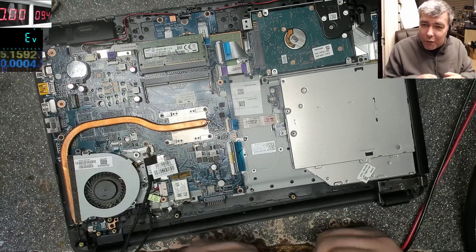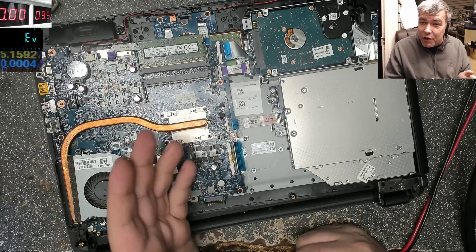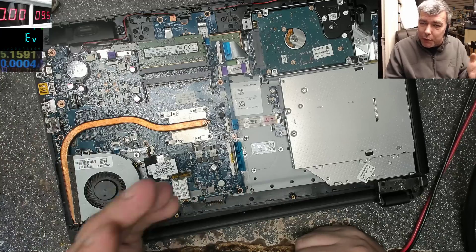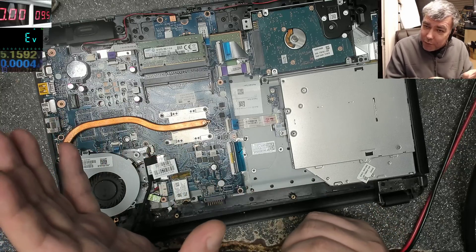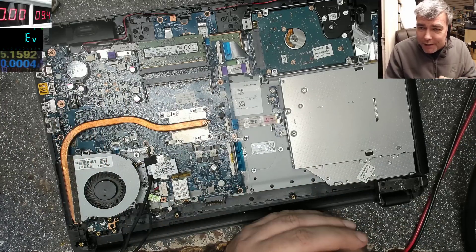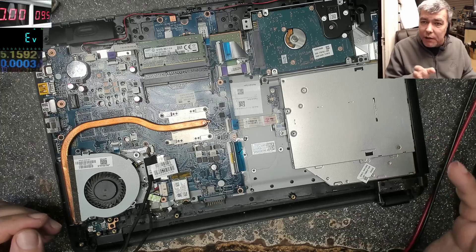We made a video about this on Lenovo — if this happens on Lenovo you have a big problem. But it looks like HP and Dell figured it out: on those laptops you can short the middle pin to ground or to plus and nothing bad will happen to the board. So the same wiring configuration, but they designed it so that if you break the charging port, the board is still fine. Not Lenovo — they need a few more years.